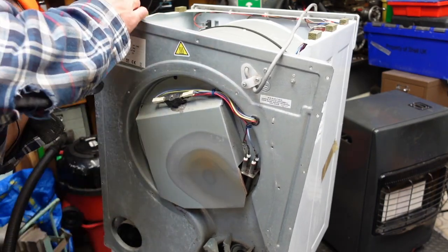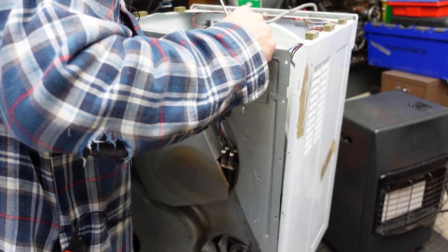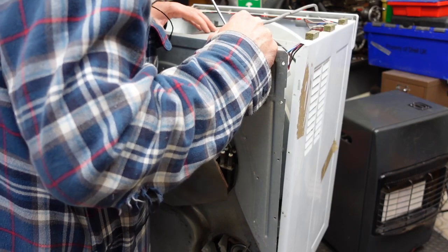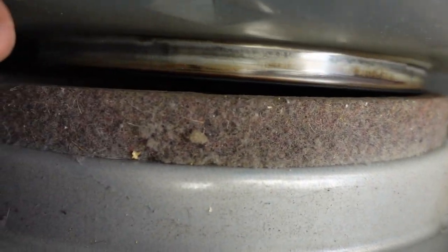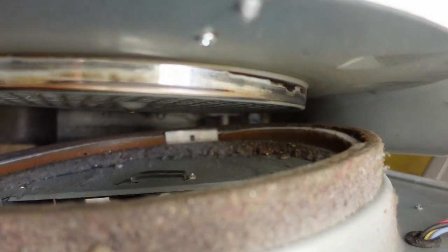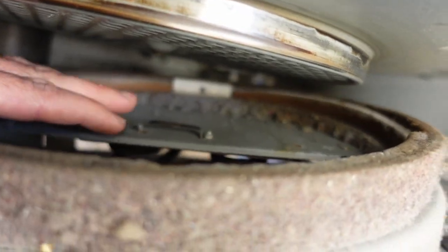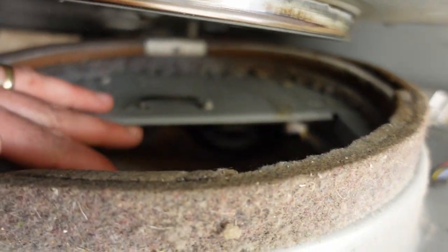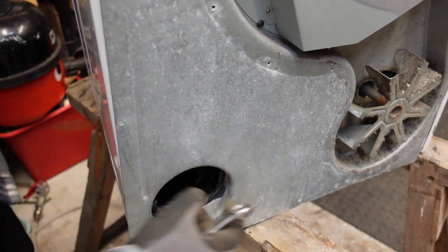I can see the capacitor is just here. If I want to slice my arms open, maybe I can do it without going too hard. The other option is to get the drum out. The drum just rests on two nylon bearings. You can see that white thing in the center — those are bushes or something, and the drum just rests on them. There's a bit of lint built up in there but nothing major. That looks to be a bi-metallic switch, just in the center, presumably for overheating. And there is scorching on the tin work in there — but it's not bad, it's just heat. So the capacitor is just in there. I've got a 13mm spanner and it seems to be enough to take it off. It's not the worst job in the world. Eight microfarad, two-wire arrangement.